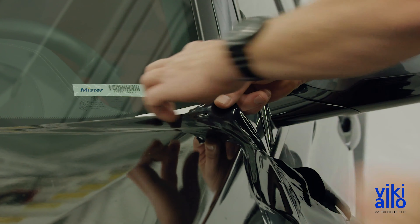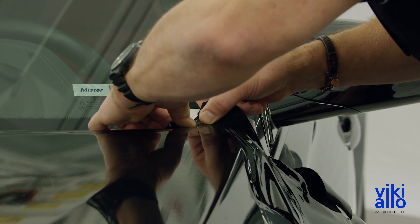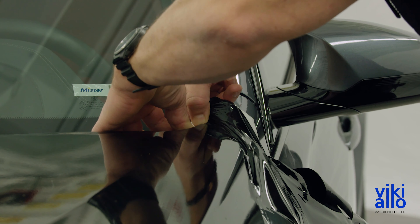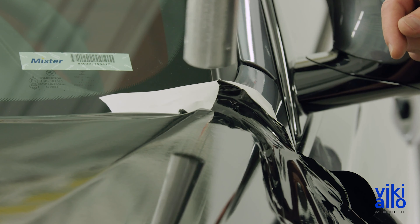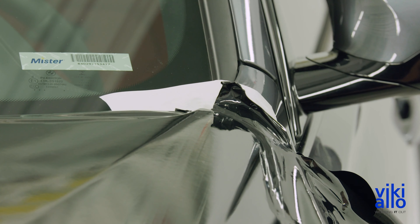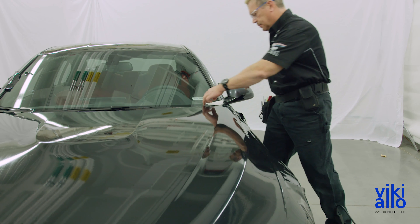Stretch the film at the top corners of the hood, using a piece of liner to prevent adhesion to the windshield. Place the material down over the corner and heat. Upon reheating the material, it will shrink back to its original size, resulting in a perfect tucking of the material underneath the body panel.